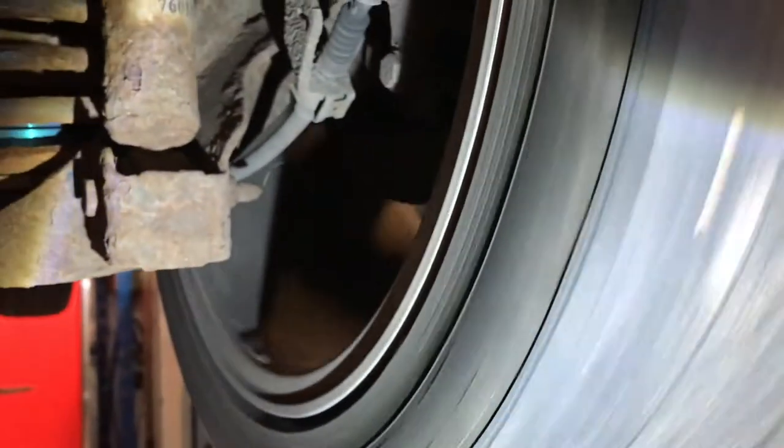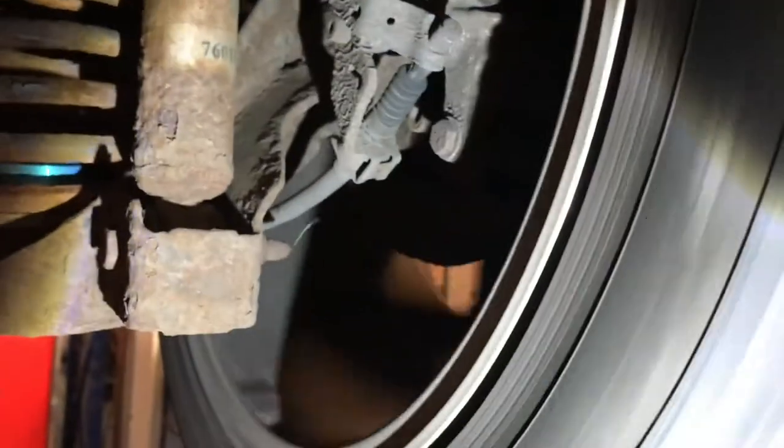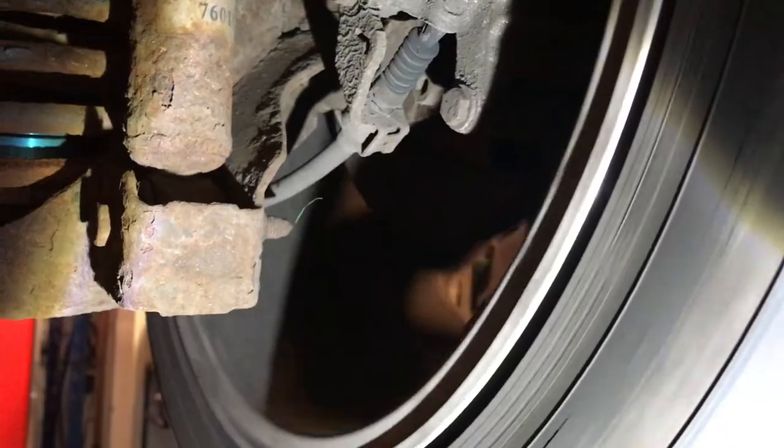The other side rear tyre is bald on the inside edge. Just run that round and see if it's out of shape as well — it's definitely in need of a replacement. Giving it a spin, there's a slight imperfection in that tyre, but nothing I would say is causing that vibration. That one is good.